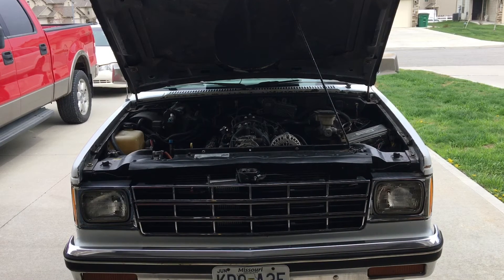What I also found out is the 24.8 lb injectors I have are too small, and the extra set of 2002 injectors at 25.2 lb are also too small. The owner at House of Boost says if I'm going to be in the neighborhood of close to 400 horsepower, he's recommending I get a set of either 27 or 30 pound injectors so they're not maxed out trying to feed the engine at that power level. That's where I'm at today. Appreciate you guys watching — hopefully you have a good weekend. Please like, subscribe, share, hit the bell. Thank you.